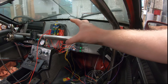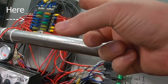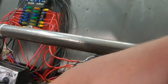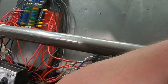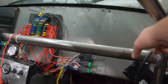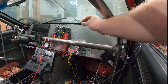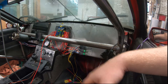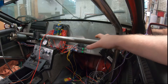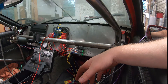On the left side that's where I have all my wires ran for my ignition triggers — I want to clean that up and give it its own spot. So we'll have the bus bar for the inputs and outputs, a spot just for key-on, another spot just for 5-volt, and all the spots for the inputs and outputs, and then all the relays below it. That way it's a little bit cleaner and a little bit easier to work with and to troubleshoot if there's an issue.